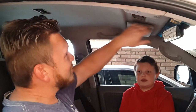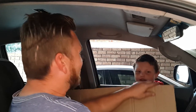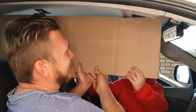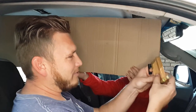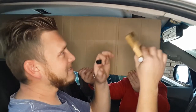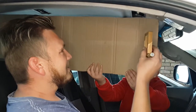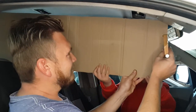The first challenge I'm facing is how to get the contoured line of the roof traced so I can put that onto the material I'll use to build the console. The best idea I could come up with was to take a long piece of cardboard from a box and ask Ruben to hold it against the roof. I'm going to take a permanent marker taped to the end of a wooden block — taped on the other end too so it's smooth and won't hurt the wood lining when I rub it against the ceiling board.